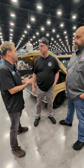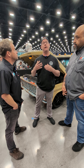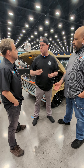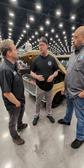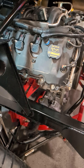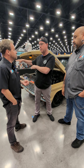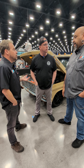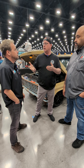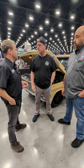You've solved a lot of problems and given a very affordable product for somebody that wants modern suspension on an F100 truck. The S550 rear, right off the bat from the factory, gives you 31 spline axles, posi-traction, 13-inch disc brakes on the back, a parking brake, and aftermarket support galore — bigger sway bars, tubular control arms, whatever you want. And if you reach for an aftermarket brake kit, with those types of numbers the six-piston calipers and all that kind of stuff get very expensive, especially when you're buying kits to put them on other things. There are no kits here. You just order brakes for a Mustang — 15-inch, 14-inch, Wilwood, Brembo, anything you want. It's a parts store thing if something goes wrong: hoses, pads, whatever.